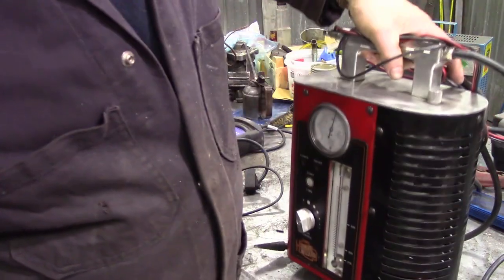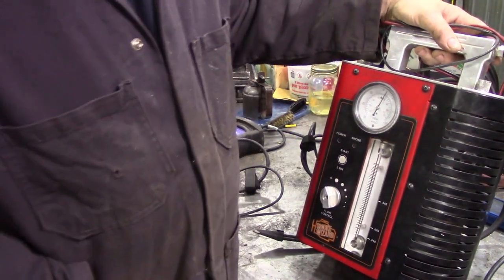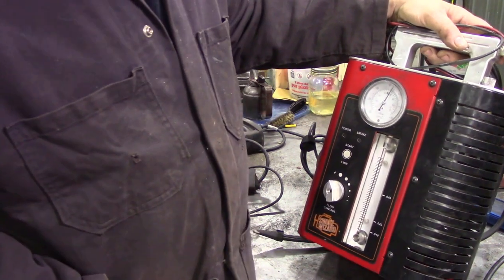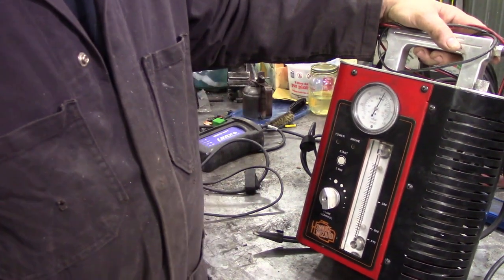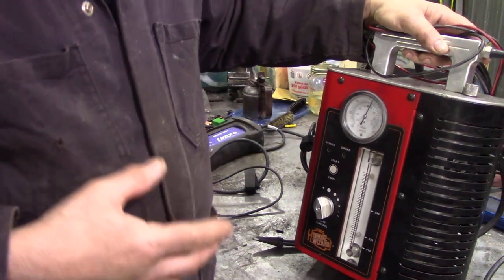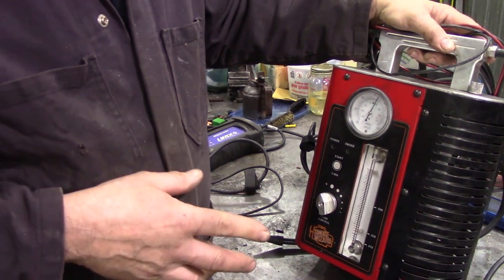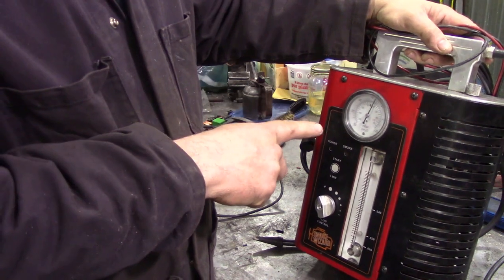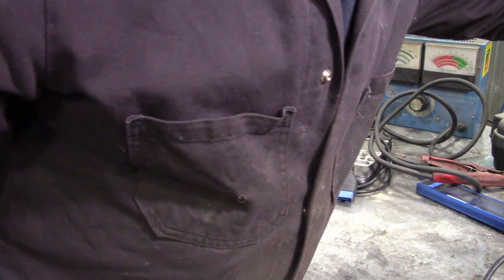This was expensive — it's a smoke machine for testing for leaks and emission control systems, but it's got so many uses in the shop it's unbelievable. I can pressure test and smoke test an engine before I put it in and find out if there are any leaks. That has paid for itself even though it was expensive.